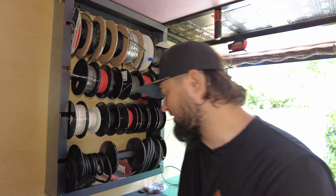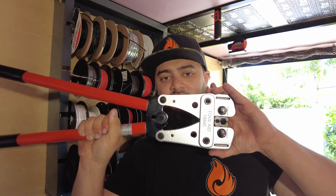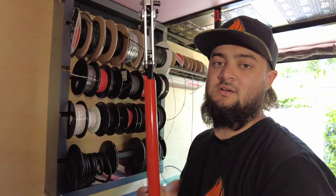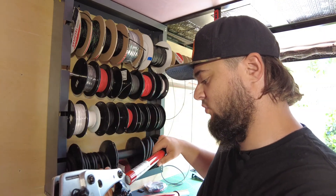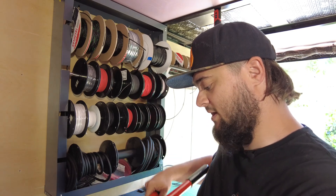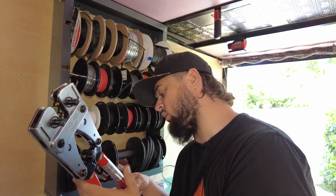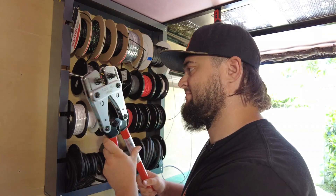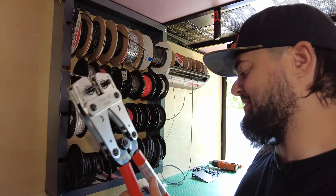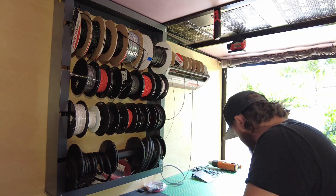For the larger wire, I occasionally use these guys from Tool Aid — they are very large crimpers meant for bigger cable. This will handle four gauge all the way up to 4-ought. You can run eight gauge on the thick wall copper terminals, but these things are massive — you're not really going to be crimping eight gauge connections with this.